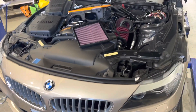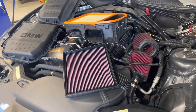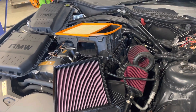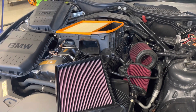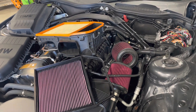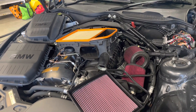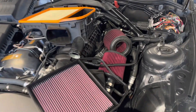The test car is a 2009 BMW Z4 with the N54 engine. Modifications include RB2 Plus turbos running 10 PSI of boost, RB silicon inlets, VRSF two-inch outlets, Evolution Raceworks five-and-a-half-inch intercooler, VRSF catalyst downpipes, Eisenmann race exhaust, Reflex Plus port injection controller, Black Market Parts port injection plate with Bosch 750cc injectors, and a Walbro 535 low pressure fuel pump.